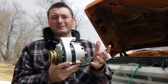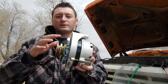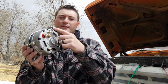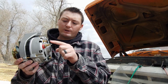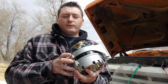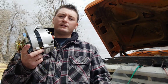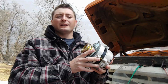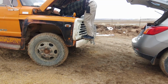You want to get them nice and tight, not too tight that they're gonna slip on the pulley as it's turning, but tight enough that they'll spin everything on both accessory drives there. And then it's the 3 bolts in back on the electronic side. I believe that it's the black one, the other little black one or red one, I'm not sure what it is, and then the bigger red one here. If you do want a repair video on this, go ahead and jump back on my channel, check out part 1, the alternator removal video of this truck, because there I do walk you through how to take this out of your F600, and apparently it's good for like 30 years of truck.